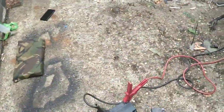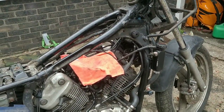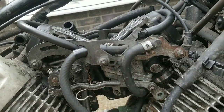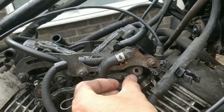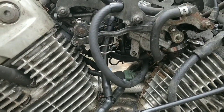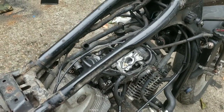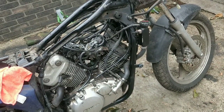That's really annoying - the Bandit battery is probably dead. I'm going to charge both batteries. I think it will fire up. It's more likely now that I need to do a proper carb clean - these carbs are so complex. One of the carbs froze off, which means I was only starting on one and they were out of sync. That was probably part of the issue. I'm not sure where I'm really going with this now - it's a tough one.